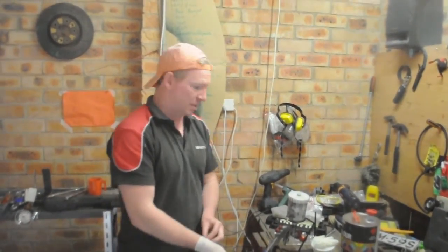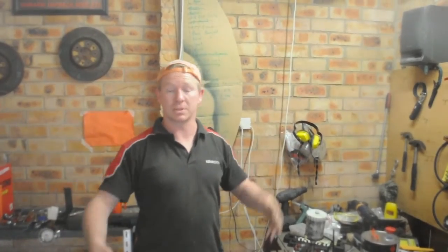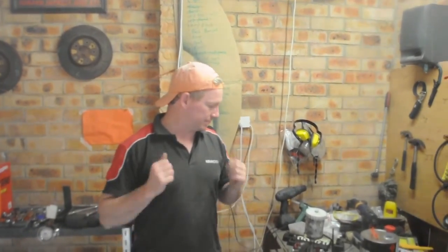Done. So now we're going to leave that for about 10 or 15 minutes. Let that dry, and then we'll come back and we'll do it again. Build up the filler, build up the primer, and get out of this room because it stinks.